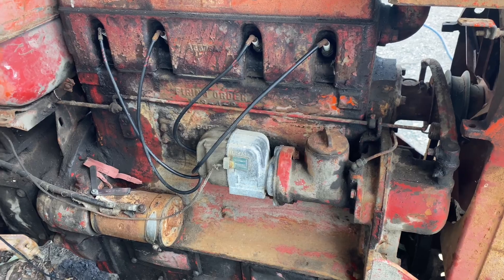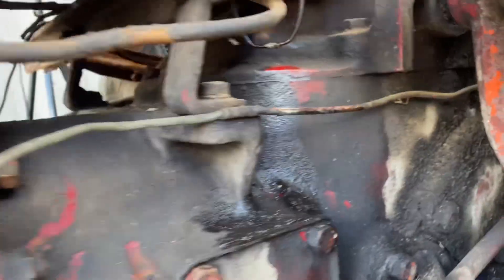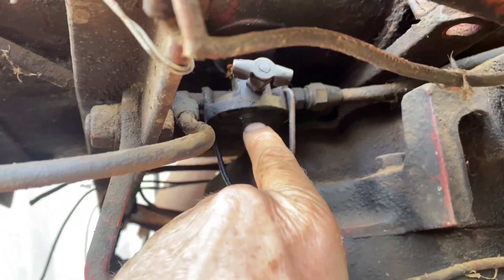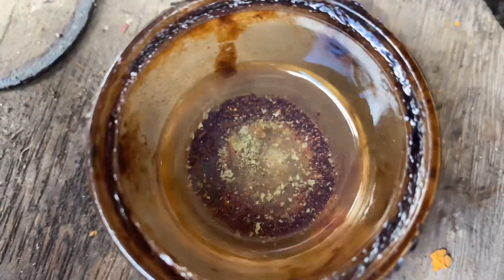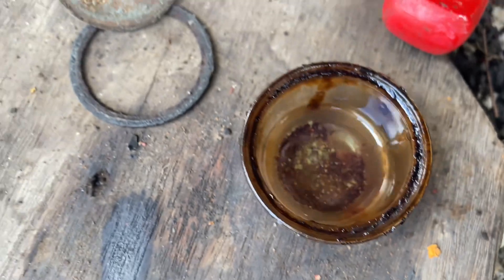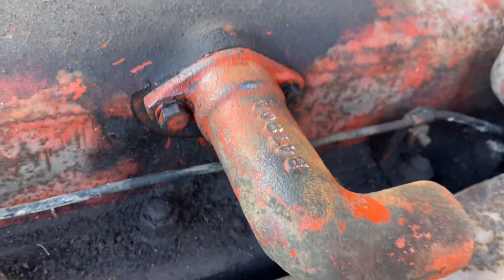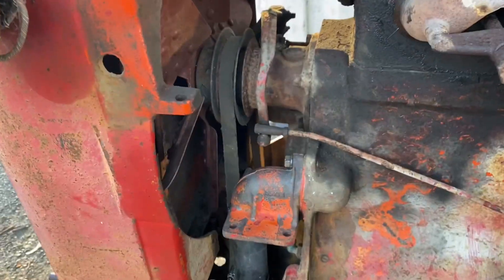Plugs are all back in. Now I'm over here — I've got the fuel bowl off. That's the petrol line: you undo that and you get kerosene out, and then this is the line for the carby. I'll have a bit of a clean out here. Definitely plenty of water been in there. I've cleaned the little fuel bowl out — took me a while mucking around getting a gasket. Got a bit of choke on, fuel all hooked up, got some petrol in the tank, kerosene in there. I've cleaned this breather out and had to put a new hose on — all back together, no water in it at the moment.